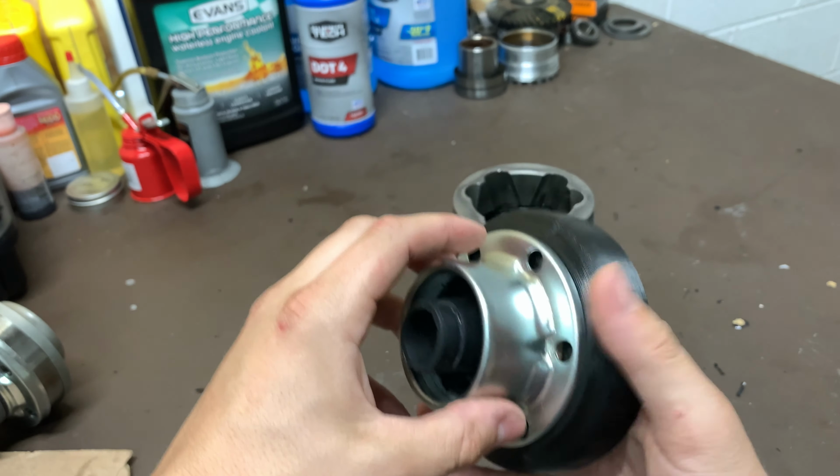We can lower the jack a little bit. See? There is tons of room now between those bolts and the control arm, and also my black adapter and the control arm. You gotta remember, there's also a bump stop that's never gonna let it actually get up. But look, you can just keep going and going. Just when it bottoms out on the subframe is just when this starts hitting the control arm. So it's perfect.